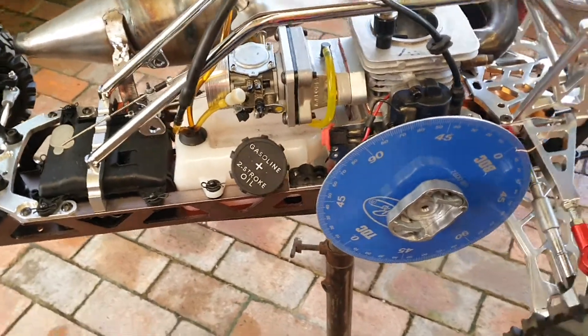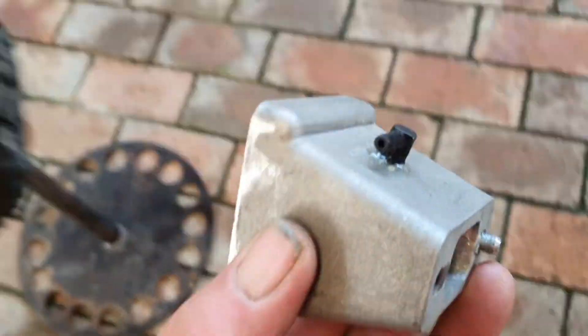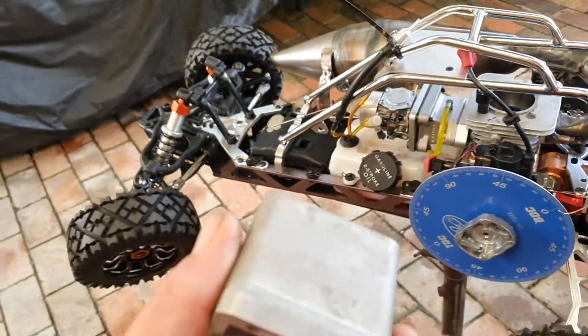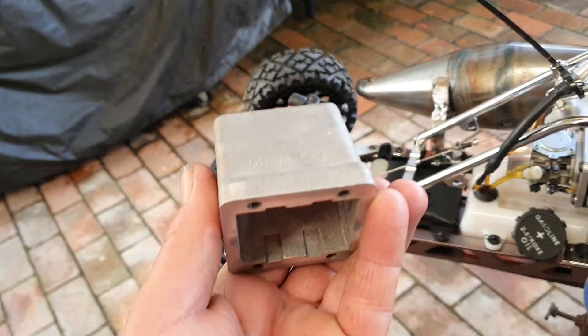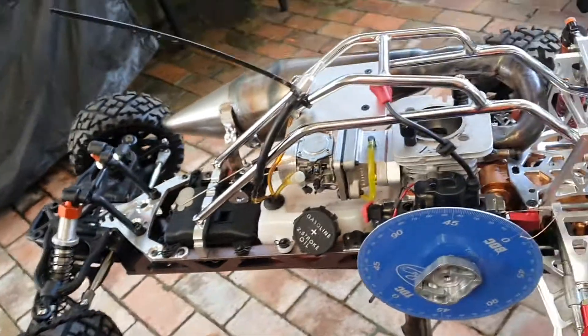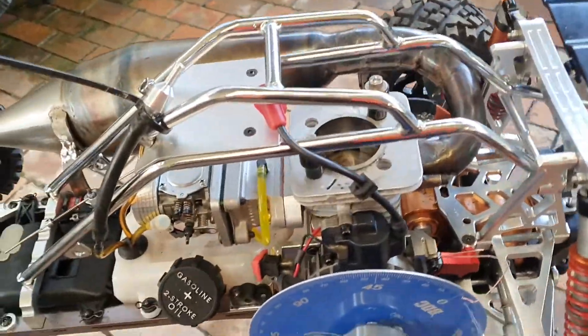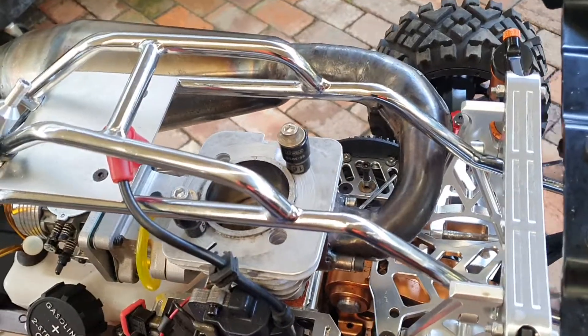I suspect, most likely, the reed - I ran the Chinese one. That's that one there. It ran on my other 71cc motor, but that one had extra two transfer ports. On this one I've basically only done the single boost port, just opened up the exhaust and changed the blow down.